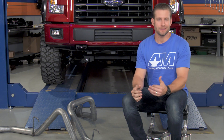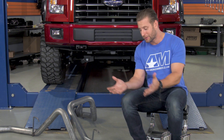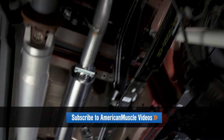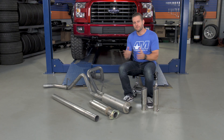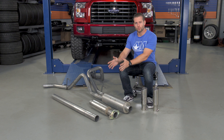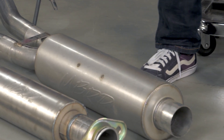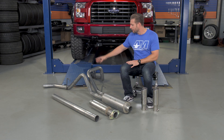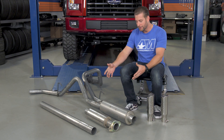If this thing is still a little too much for you and you're having problems justifying this to the wife, MBRP does offer a single exit system that's even more affordable and it's even full three inch from tip to tip. On the topic of pipe diameter, we are looking at a three inch system coming off the cat leading into the single bullet muffler and into a large resonator, before splitting off into two and a half inch tubing leading out to large three and a half inch polished tips embossed with the MBRP logo.